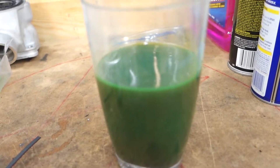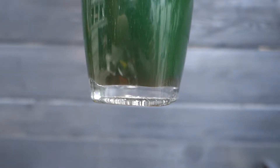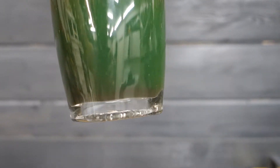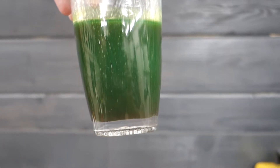I've put a few heat cycles through the KTM and as far as I can tell the coolant isn't moving — I'm not seeing any leaks. There's nothing going on with the oil. I did drain off a little bit because the oil level was a little full. After reading the manual, you're supposed to check it when the bike's warm, so I let it warm up, checked the level, drained some. We've got a nice green color, but I did notice there's a slight line at the bottom. This could just be sludge falling out of the oil, but it also kind of looks like coolant, so I'm not exactly sure.